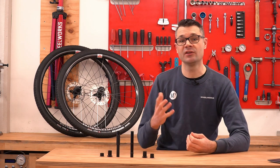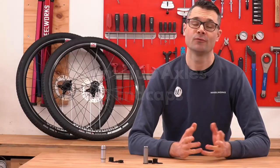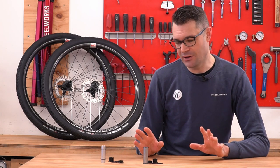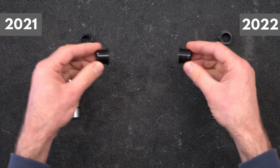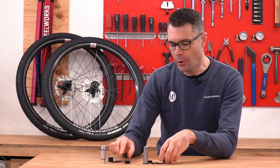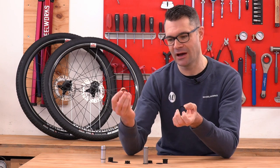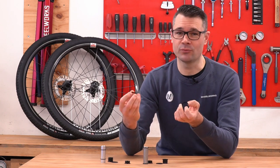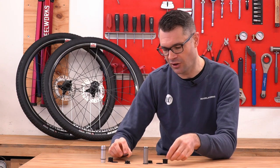Overall, awesome to see that these upgrades have been hidden away inside the hub, but they do come at a massive weight saving. Front hub axles and end caps — much like the rear hub, there's been small changes here but nothing significant. The end caps have gone from the constant diameter 2021 versions to having a similar notch on the 2022 that will make it a little bit easier to pull them off. Both of them still use that rather silly little system where the little cover thing presses on. It kind of works, but it's a bit frustrating, and it's a really good thing that the DT Swiss bearings last so long because they are one of the more difficult front hubs to service the bearing on because of these little dust shields.